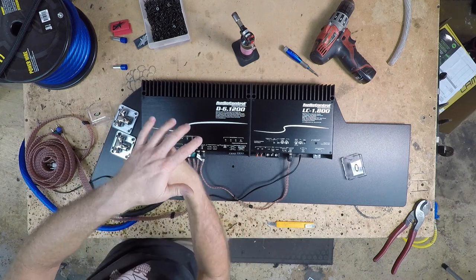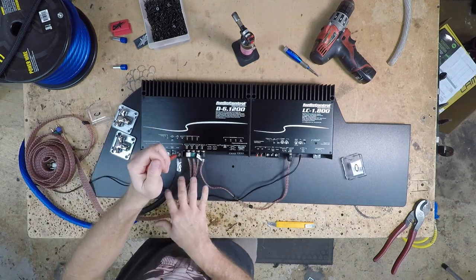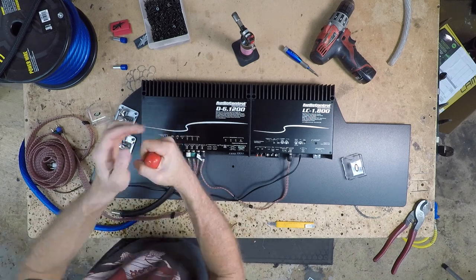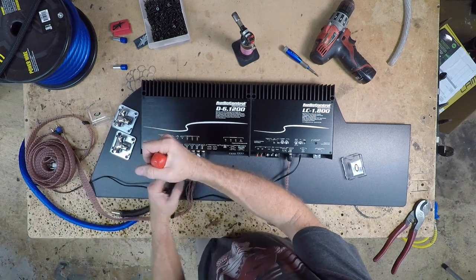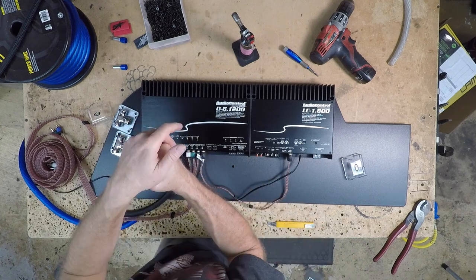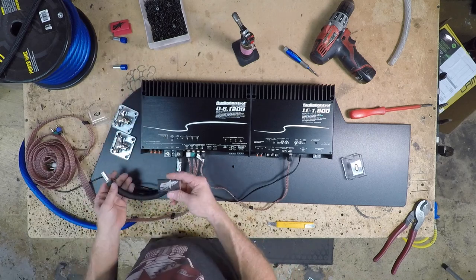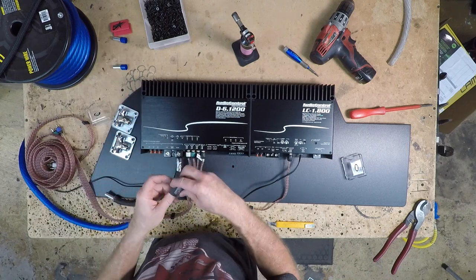Now depending on what you want to do with the wire is whether or not you should work with it when the heat shrink is hot or cold. You want that to not bunch up or get any wrinkles in it. Wait till it cools down a couple minutes, or if you need it to bend, work with it when it's hot. The other thing too is if you are using a logoed heat shrink, make sure they all go the same direction.